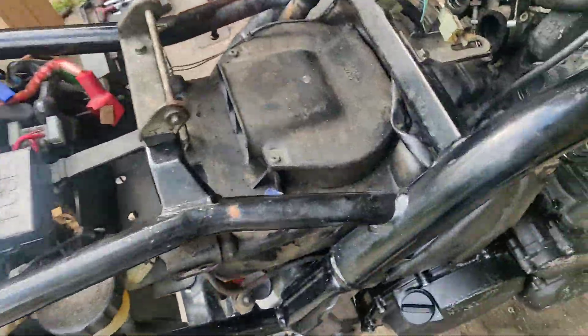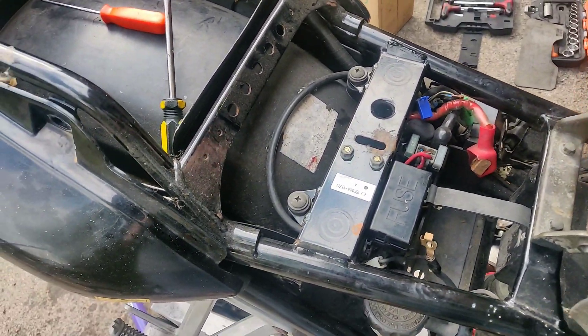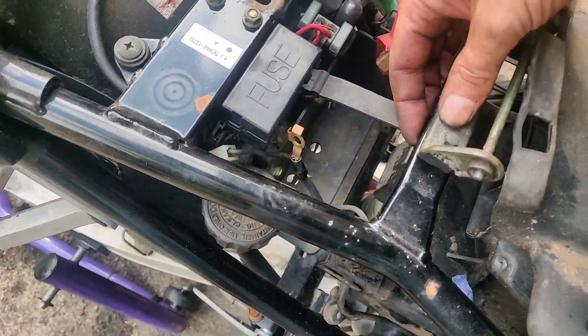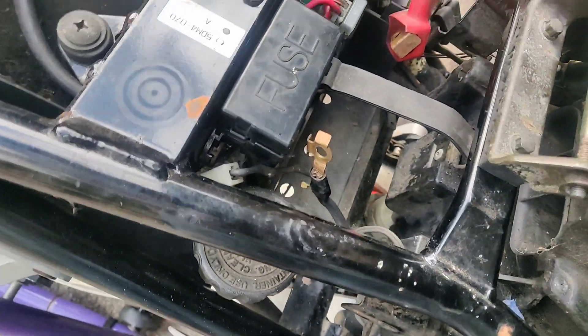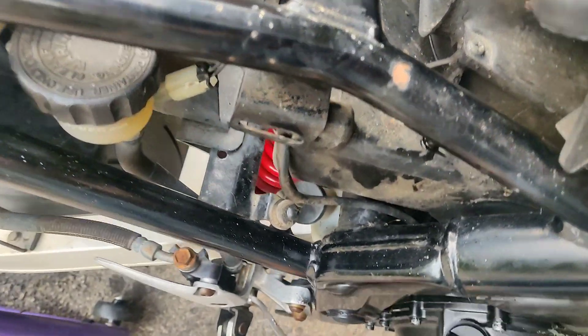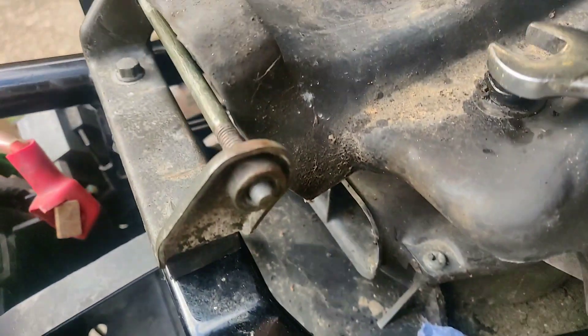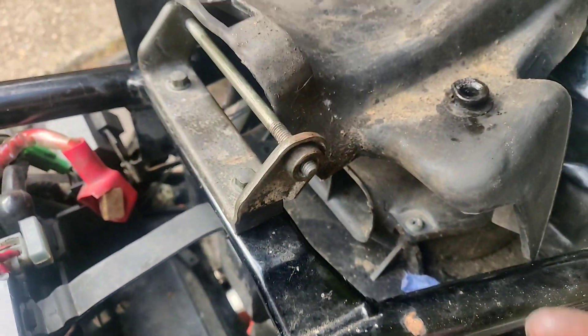Carb's out. Trying to see if I can get the air box out before the engine moves or not. It had this plastic/rubber sheathing — it's attached under the bar, sandwiched through. I noticed the other one had a middle bit in there, just to stop it rattling. Then it's wedged up through the two stoppers at the bottom, which was a bit of a bitch to get out. It's a case of effectively a large spanner — just push it until it pushes through that lump.